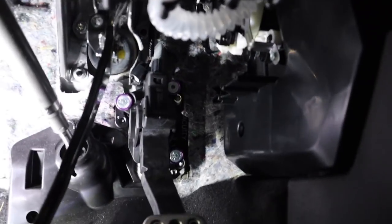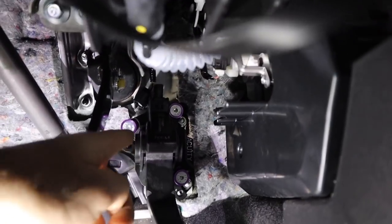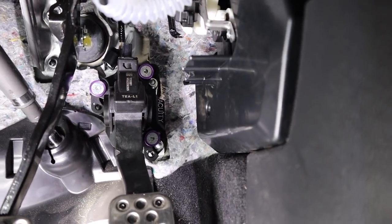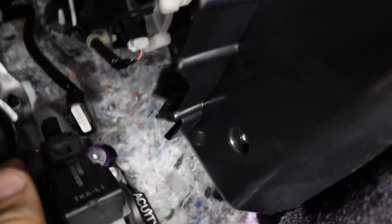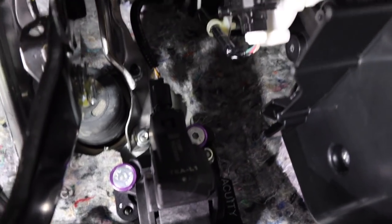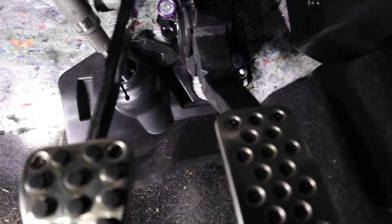The last thing you need to do — I now have all of the supplied hardware in. If you do have a torque wrench, you want to make sure those are torqued down to 10 foot-pounds of torque. Then last but not least, go ahead and plug your cable back up. This is my K-Tuner wiring — I need to tuck it a little better. Let's get the actual electronic piece covered back up and put on — make sure you hear a nice little click. That's now back on. And I'll show you what the actual throttle pedal looks like.